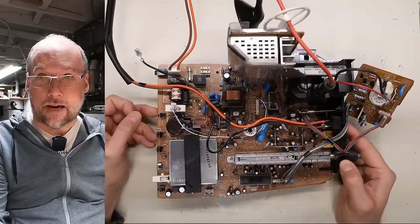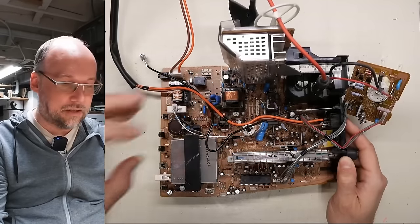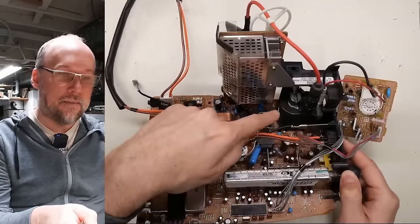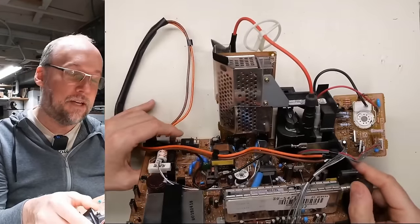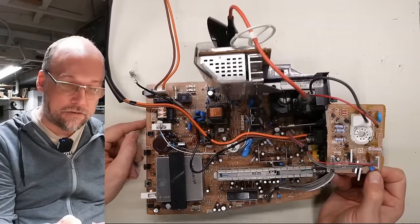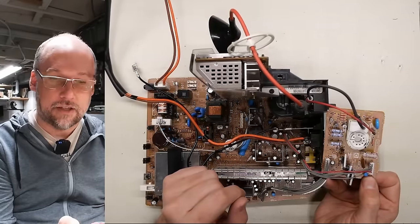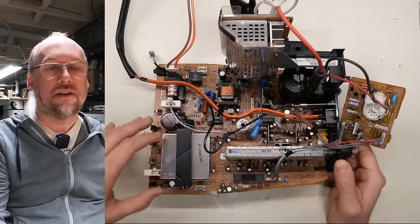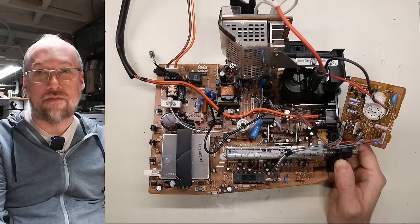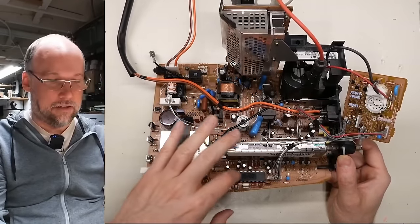What you see on the bench here are the actual guts — all the electronics inside that little set. Right now all that's left in there is the deflection yoke and the CRT. The main board does everything: power supply, tuner, microcontroller, video processing, horizontal and vertical deflection, and the flyback transformer that generates the high voltage. This set also has a DC-to-DC converter for the 12-volt supply. There's another small PCB that plugs into the back of the CRT, taking RGB signals processed by one IC and converting them to the levels needed to drive the CRT. If you looked at a TV from 1985, it would be far more complicated — they really figured out how to condense large amounts of circuitry down to single chips, like this 48-pin one right here.